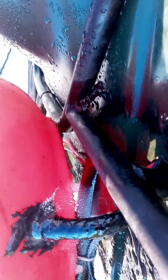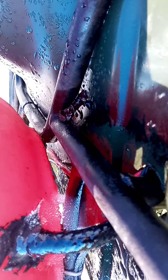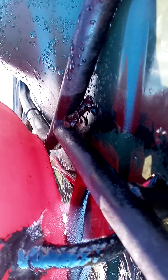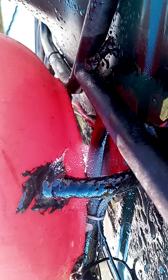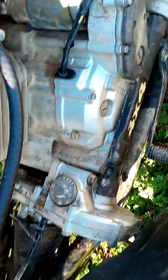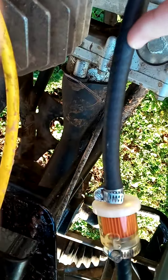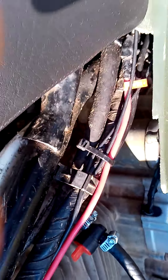Get you a double-sided male plug — both ends are open. Drill you a hole and put that in there. Use some JB Weld. Run your line however you want, cut it and put a filter on there. Then you put a shut off and run it on into your carburetor.